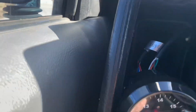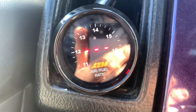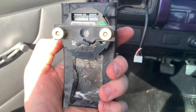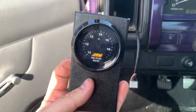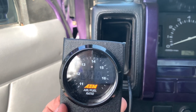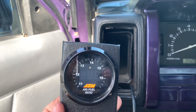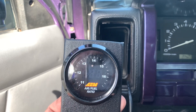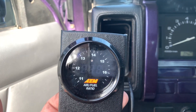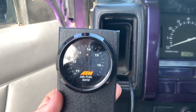I don't know what happened — I'm just taking a video in case anybody else has this issue. My gauge just all of a sudden started going blank. I'm hoping it's not too close to the exit of my manifold getting too hot, but I don't know — that doesn't really seem to be the case. I did set it back quite a ways. Now we have our gauge set up in the pod. One thing I already noticed is I'm getting these three lines — like the thing is completely just leaned out. A lot of people apparently right from factory have issues with the O2 sensor. I'm going to drop a link in the description if I end up having to go with getting another O2 sensor, which is just crazy because this gauge is like $170. To be getting a bad O2 sensor right out of the box is not a great look for AEM, and I've seen a lot of people having the same issue. I probably would recommend going with a different wideband sensor, but we're going to plug this in and give it a go again.